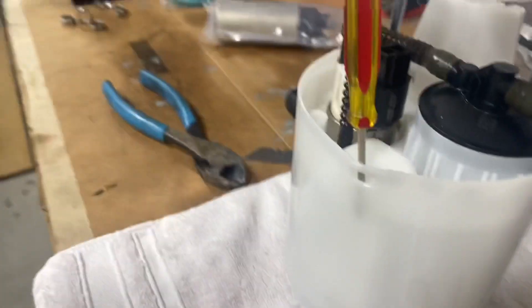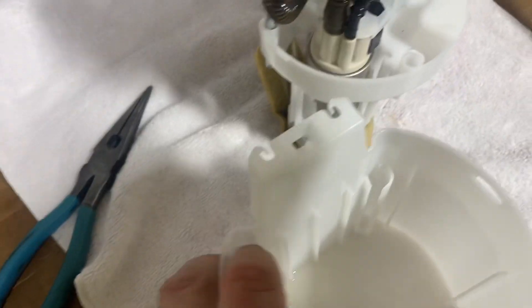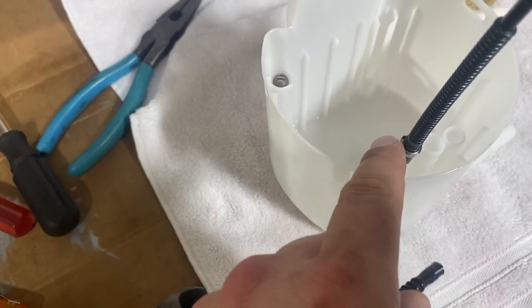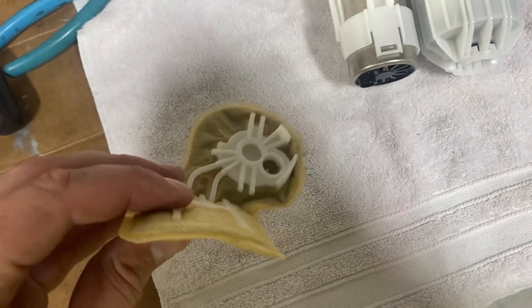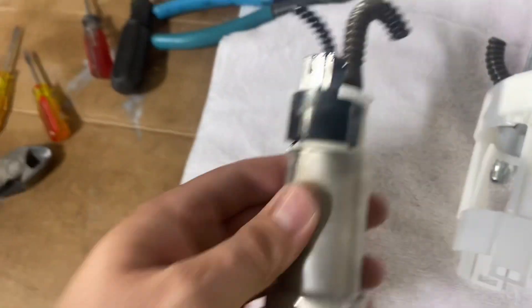Trying the old three screwdriver method to release those tangs. I got them separated - I see one spring and it looks like there is only one spring, so that's good. I took a razor blade and carefully sliced the line right here, took the stock one removed, and slid the one that comes with the kit all the way down on there. Make sure you've got your little piece on there, then take a pair of dykes and just crimp that so it holds it in place. The stock fuel sock or pre-filter comes off with just one little clip, and then you can just slide the fuel pump out the bottom.